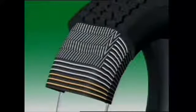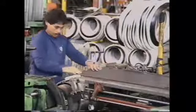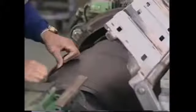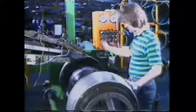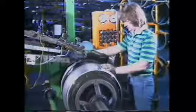Radial ply tires are usually manufactured in stages. The casing is initially formed by laying the rubber inner liner and the first layer of textile ply cords around a flat drum mould. The rubber covered bead wire and side walls are then locked into position. The rubber's side walls protect a finished tire from curb damage and weathering. At the second stage building machine, the tire is shaped.